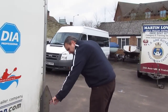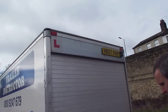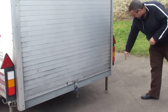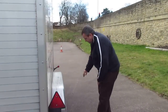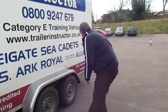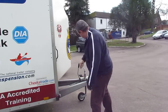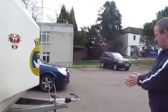Again checking lenses at the back of the trailer, making sure the number plate is in place. If I haven't got a number plate I'll put it on. Making sure the plate floors are locked so that when I drive along nothing falls out. Checking lenses again, making sure they're all in good condition. Condition of the trailer, this side of the tyres, making sure no cuts or bulges. Checking lenses at the front, and then just to be safe, making sure the handbrake is definitely on. I'm happy to back up to that — I know it's not going to move away and I know it's okay to tow, so now I'll reverse back up to it.